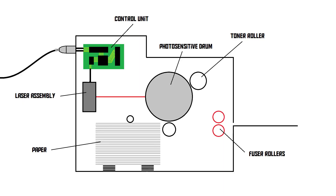And now we can see it. The only thing we have to do now is take a piece of paper and run it along the photosensitive drum, which is covered in toner. The toner will then go onto the piece of paper, and now we have an image on that piece of paper. Finally, we run the piece of paper through a couple of very hot rollers to properly fuse the toner onto the piece of paper permanently — and there it is, a picture on the piece of paper.